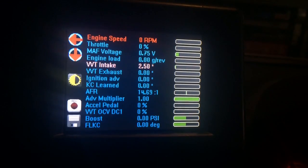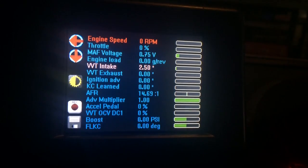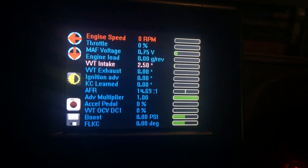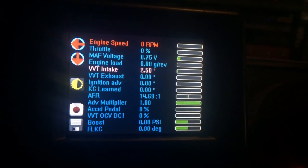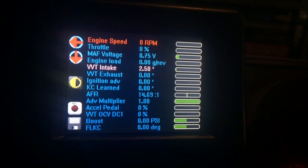There's always a slight bit of current draw due to the OFT even with the screen off. So we don't recommend leaving it in for days on end, because in situations like long-term parking at the airport, for example, you may come back and find a dead battery.